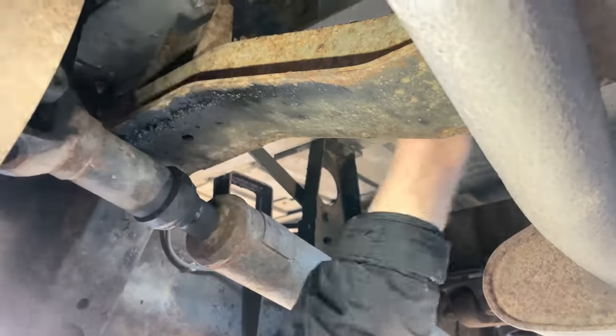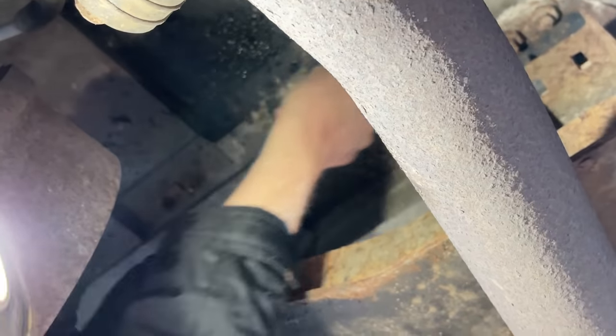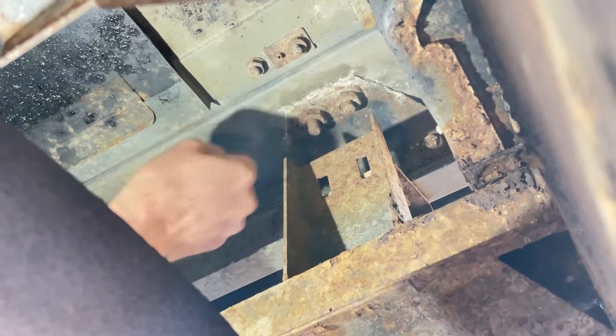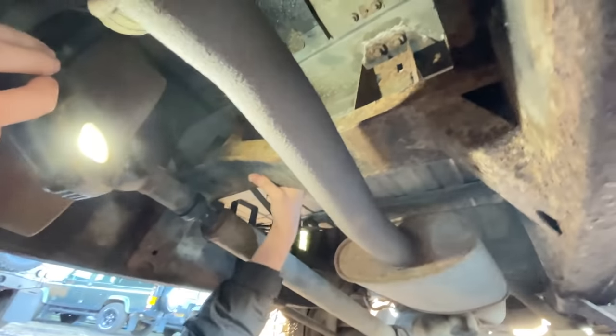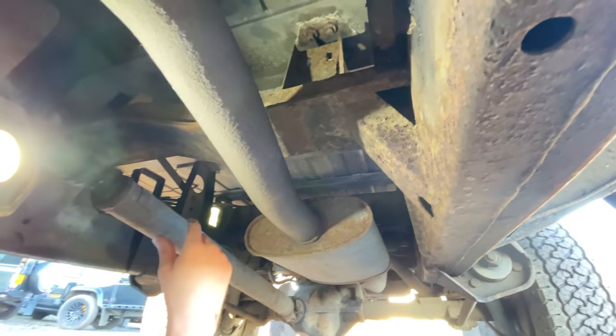From up here you can see the body - the middle cross member where they mount to the body. You can see the floor pan and this is the centre seat or cubby box area. All the flooring here looks relatively clean and it's not rotten. You can see where the aluminium and the mild steel aren't best of friends and start to react - on a really bad Defender, that section will be completely corroded away. Have a good look around the floor pan where the body connects to the chassis, make sure it's not full of mud. Give the chassis a good tap with the back of your hand - you'll know if it's crunchy or crispy.